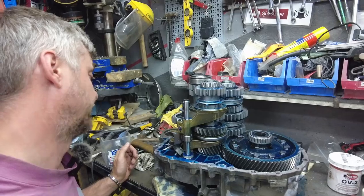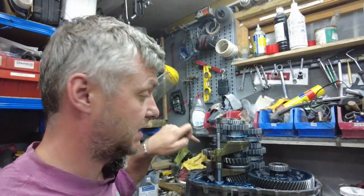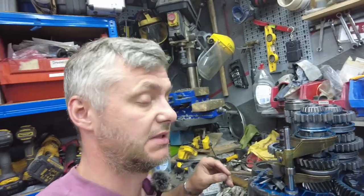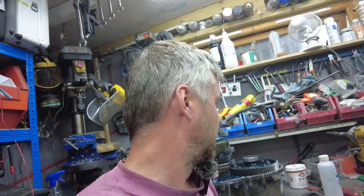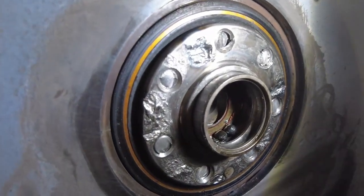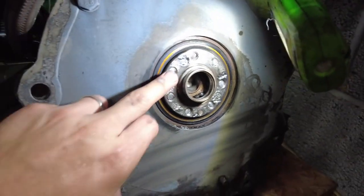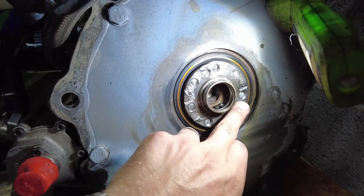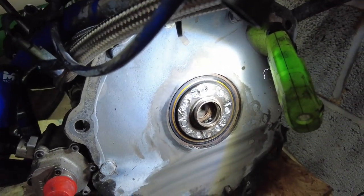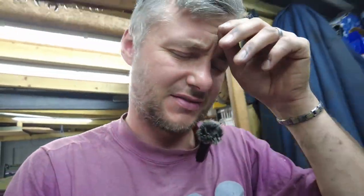So the box is apart. All of this seems to be fine — no teeth are broken, everything seems okay. But then another really bad thing: that's my crank. I think it's a 197 crank, and this is damaged. I don't know how to fix it — take it out, put it on the lathe, smooth it, or buy a new one. That is the big problem. And obviously if you take it out, you need new bolts, bearings, seals, and all that stuff.